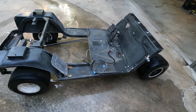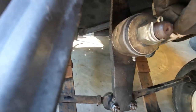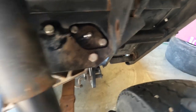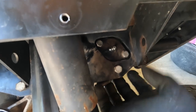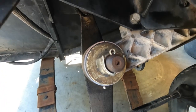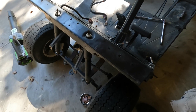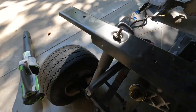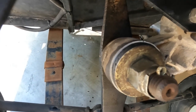At least I can work on it without getting dirty. Alright, so I got the new steering box rebuilt — or what I'm calling rebuilt. Got the new bushing in, that new sleeve bushing, and it wasn't that hard. It's actually a lot easier going back together than it was coming apart once I knew how to get this thing out. It's a little puzzle piece combination — you got to flip and pull it out. But all the play is gone, so that massive play I had in the steering — now when you touch the steering it's very responsive. You can see my movement here goes directly to the wheels. You can see this box, it's no longer flexing like it was.